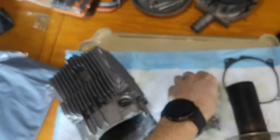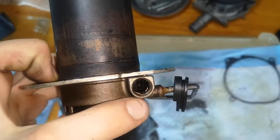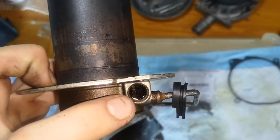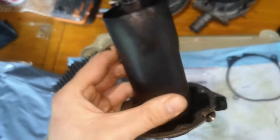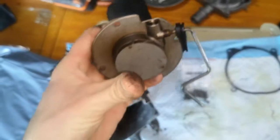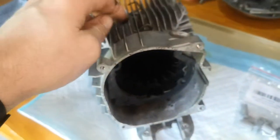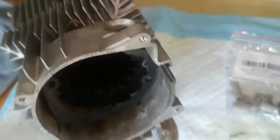The purpose of the gauze is that fuel comes in through this pipe, and because of the gauze the fuel atomizes. In there sits the glow plug which ignites the atomized fuel — this pretty much becomes like a blowtorch. All the hot burned air gets blown through there; there's a fan on this side that blows it through into this chamber, heats up this chamber, and then air blows over this and out. So the exhaust goes out there — it's fairly simple.